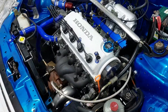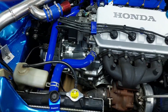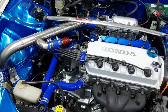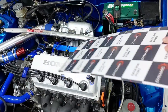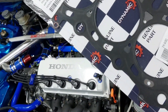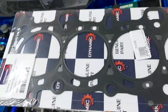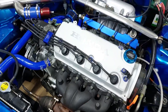The car does actually run now if you don't boost it. The head gasket leak is very very small — it just pushes small bubbles in here and the coolant system still holds pressure and it's still full if you check it, because this is the highest point so it'll push all the air into this area and then out into the bottle. It doesn't really create a problem if you don't drive it far, but we're obviously not going to drive it like that. We've got a new head gasket for it — just an off-the-market head gasket, quite cheap, the equivalent of about $25. It does say the word genuine on it. I don't really recognize the brand name but it looks exactly the same as the head gasket that's in here — like a three-layer steel one — and I haven't had many issues with them before, apart from when I do something stupid.